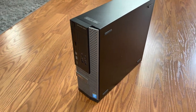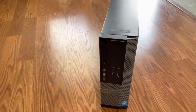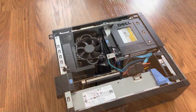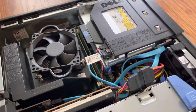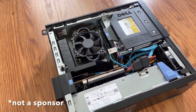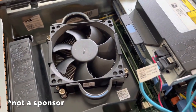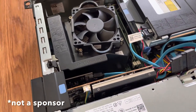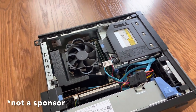To take our viewing experience into the future, we're going to be creating a Plex media server using the same Dell OptiPlex 3020 from my last video. You may be saying, hey buddy, if you're taking your viewing experience into the future, why are you using 10-year-old hardware? Well, that's easy — Dell OptiPlexes have a great processor, and Plex media servers are CPU intensive. You can put a GPU in it and that can take some of the load off the CPU, and I'm keeping it out of a landfill.